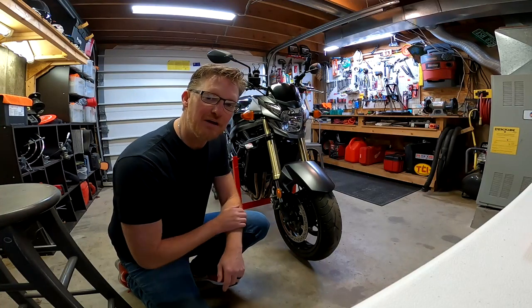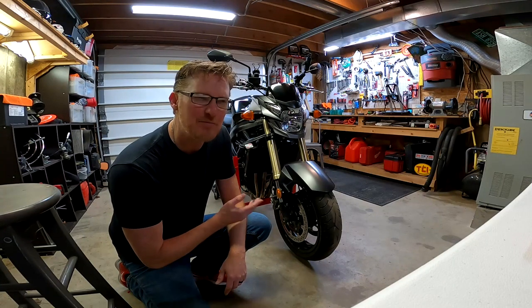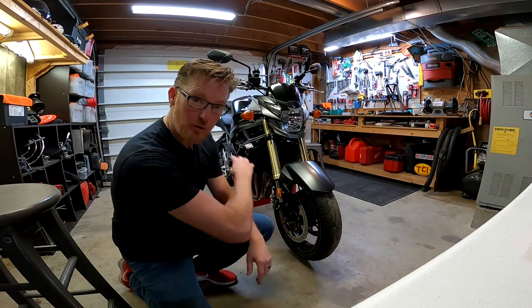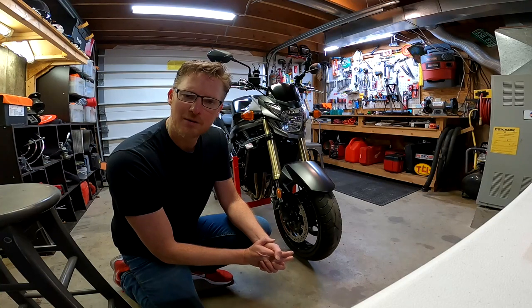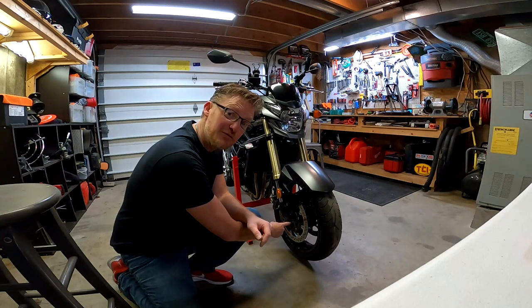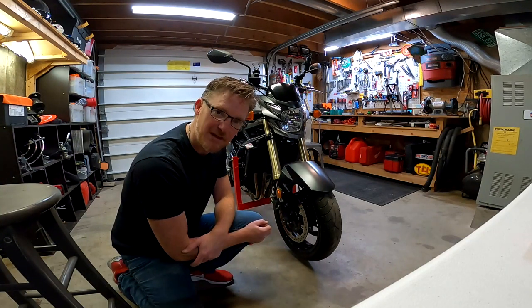Welcome back to the Man Cave. This is my 2015 GSX-S750. It has about 19,000 miles on the odometer and I've been riding it for about four seasons now. This winter I want to replace all of my fluids. Before I begin, I have a problem — I can't even get the front wheel off. The reason? A stripped head bolt down here. The thing is frozen. When I went to go remove it, the Allen wrench just stripped the head.